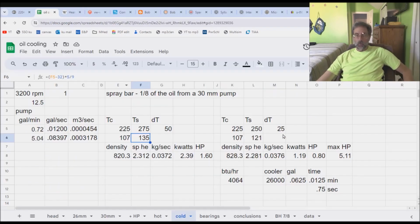This is an oil cooler. It is a device that is specifically designed to use area effectively to pull heat out. 25 degrees. Okay. On this side, we have a head that is not designed specifically to put heat into the oil. It's just a flat plate. It's got penetrations in it. It's got bumps, knobs, springs. It's a nightmare. It's got a piss poor heat transfer coefficient.